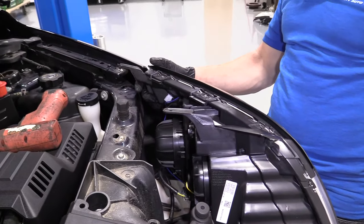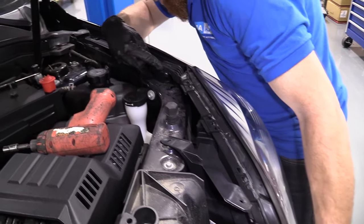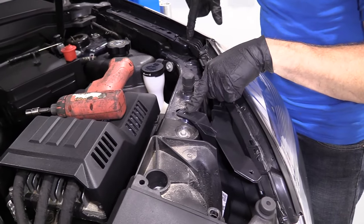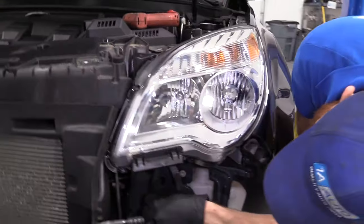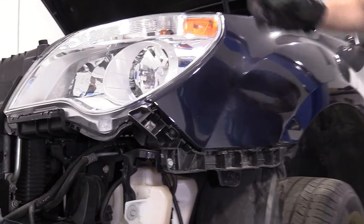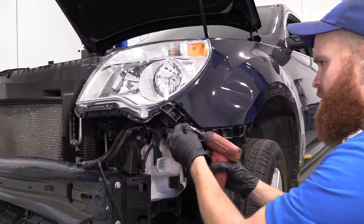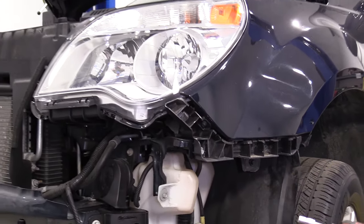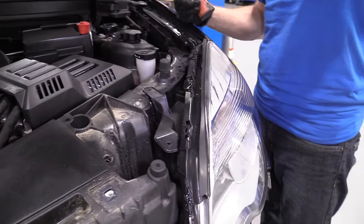Like I said before, being very careful for the paint on our fenders. I'm just going to try to bring this up and get it into our little hole that I showed you. Everything's sitting down nice and flush. We've got our hole lined up here, hole lined up there. Looking down in there it's lined up. Let's look along the bottom — make sure we don't have any wires or anything hanging or getting caught. That's our little fog lamp — that looks like it's lined up. So now we'll go ahead and put in our bolts and move along.